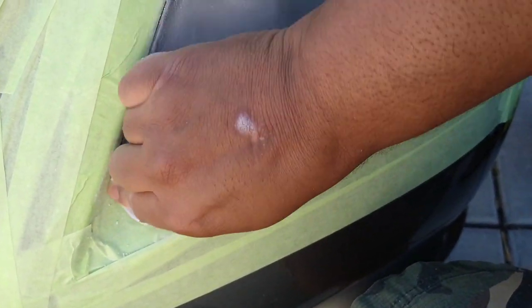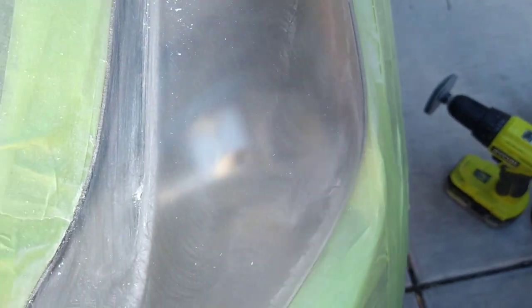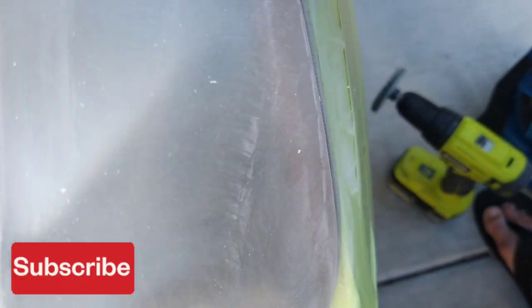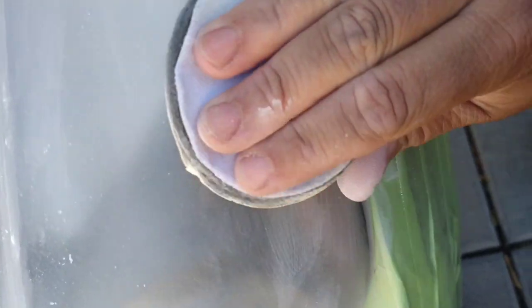This is how you really get into those corners where your drill or your three-inch pad won't reach. You take off the interface pad with the P500, and pretty much use your finger pressure to mold it into place and get it that way. Because if you try to get in there too hard with the drill on those sensitive areas of this light, you're going to end up leaving marks you can't get out — or that you'll spend a really long time trying to remove before your final step. Hand sanding gets it at these points.